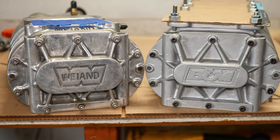Those differences aren't the only ones we're interested in — let's take a look at the engines side by side. With the bell housing surfaces lined up, you can see how much longer the big block is and how much taller it is, since they're pretty much even up at the valve covers and the 350 is sitting on quite a few wooden boards. To make a good comparison, we'll be removing the alternator and power steering pump. I just want to make a little note about these mounts — way back when installing the supercharger, I ended up with this Summit mount, and I have hated every second I've had to use it. The alternator had to be filed to fit at all, and the slot is too close to the corner, making it pretty much impossible for a bolt to grip on both sides, which ends up bending the bolts.